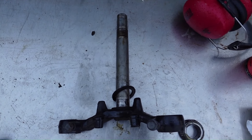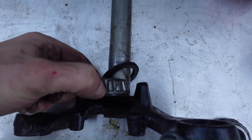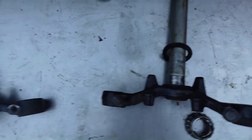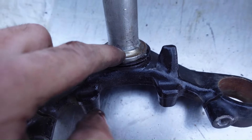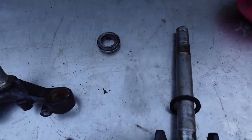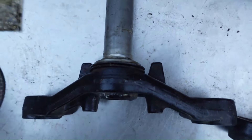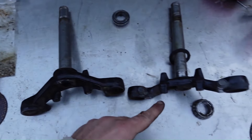The old yoke had roller bearings on it. However, the replacement yoke has the old-school ball bearings, and they're just not compatible, so I have to change over the bearings. The ball bearings sit on a cup and the cups need swapping. There's an old cup in the way that I can't get off, so I'm going to cut it off carefully on both sides, then the old one will fall away and I'll be able to put the new one on.